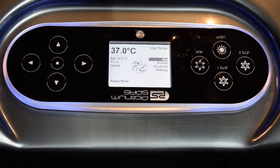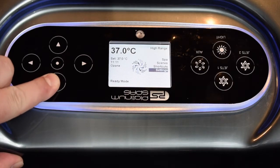A cleanup cycle basically is the tub running the circulation pump through the filters after you've got out of the spa. So typically if you've been using the jets, five minutes after you've got out of the spa and turned the jets off, the hot tub will then turn on the circulation pump and run that for a determined period of time. At the moment the default is 30 minutes.